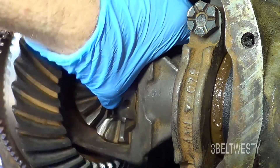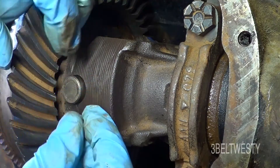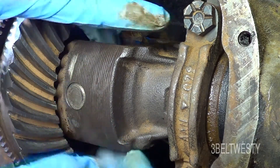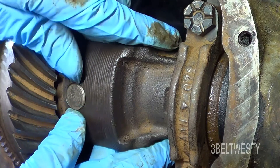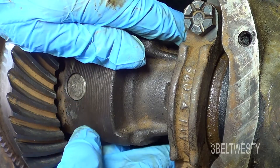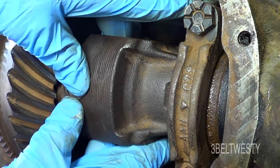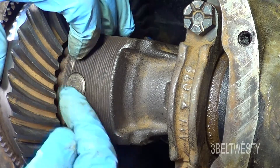One way you can do this — I saw somebody had a 4.10 gear set with the same issue. It turns out the side that doesn't have the bolt hole has less material to remove. This may sound like a big sin, but you can go through and buzz off just the edge of this tooth to clear the pin. I went through, put paper here to protect things, and just buzzed a little bit off this tooth.